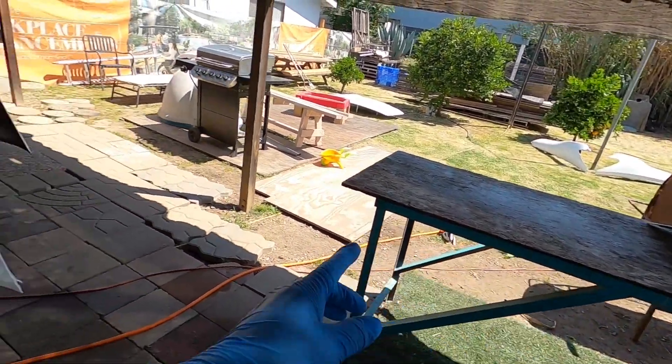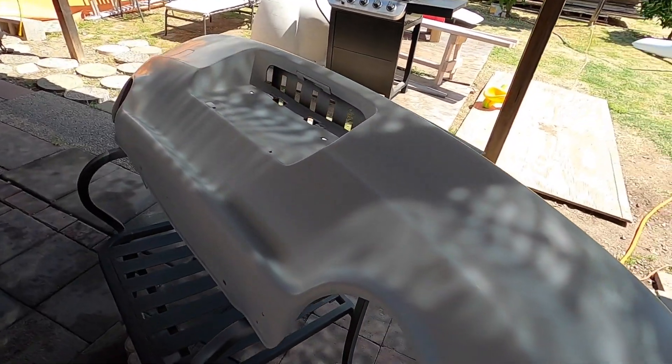Welcome back to another video. I chose a color for the STK and I'm not sure if I'm gonna show you guys just yet, but I am painting the trunk and the rear bumper. This paint is a three-stage paint — it involves a base coat, it has some pearl in it, and then on top of that we add the clear coat. I've never sprayed anything with pearl before, but it doesn't seem any different from spraying base coat or clear coat. I'm gonna try not to mess up because this paint was really expensive — I am NOT about to pay another $680 for three quarts of pearl.